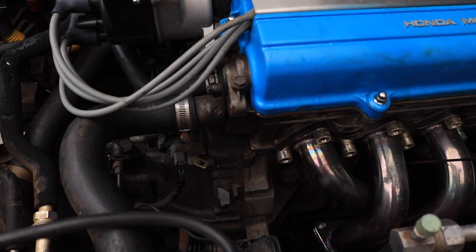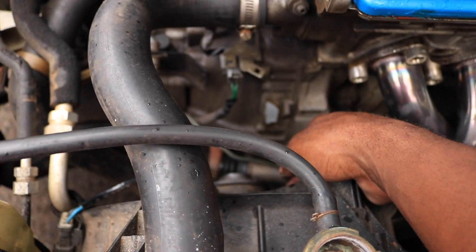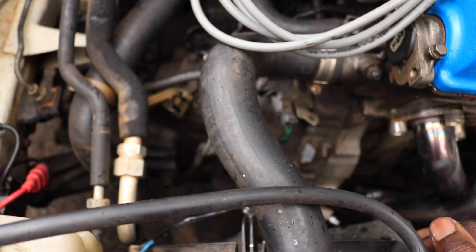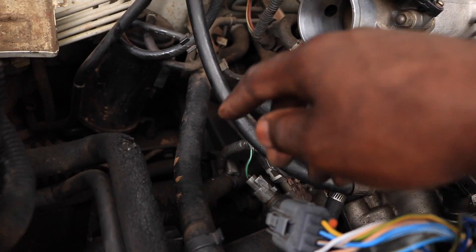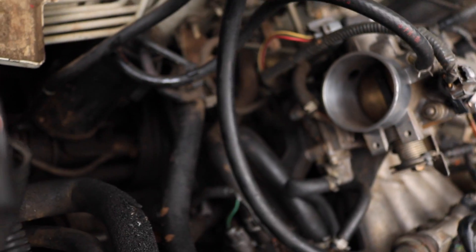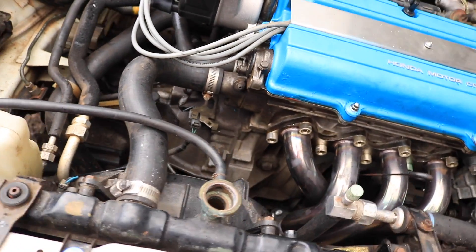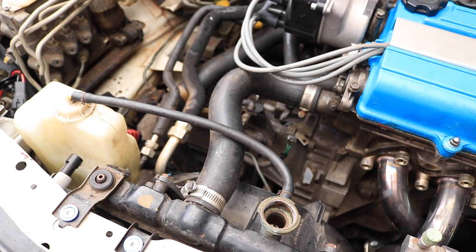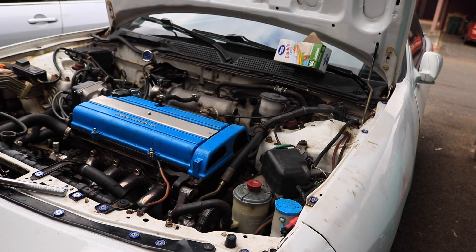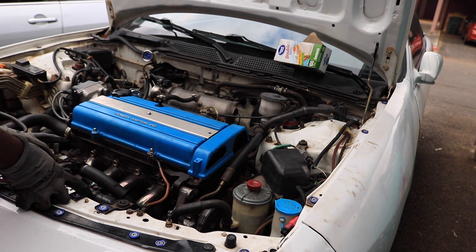The other thing I got to do is take off this plug - disconnect this plug. I got to disconnect that, take off the slave cylinder, push slave cylinder, and transmission grounds, VSS sensor - it's back here. Do that then I got to take some of the hoses off for the block. I'm also going to take the header off. I'll take the header off when I get the sensors off, then go from there. Transmission ground is off, all the speed sensor and everything is just connected - I'm going to go ahead and start unbolting the header.